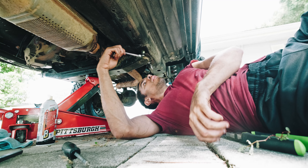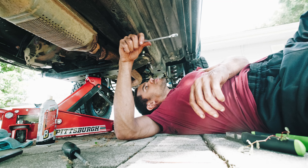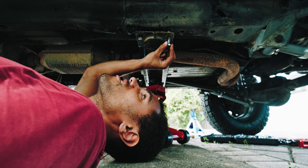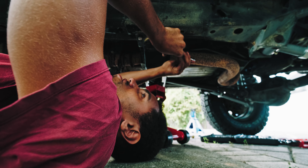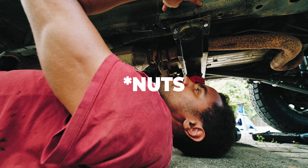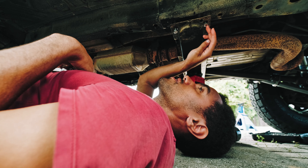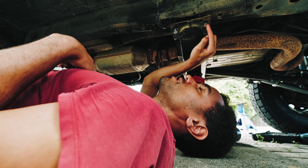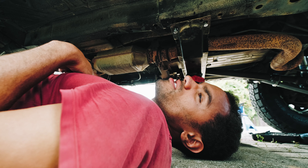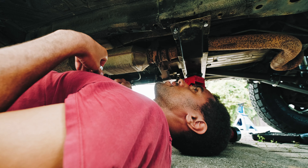This kit didn't come with washers — it fits, but you know what washers do. The only thing people were saying online was to keep the old hardware in case you want to install an SYE later. Looking online, people say it's common to actually strip the bolts inside, and a common fix is to tap to 7/16 thread — basically go up a size, get a new bolt, re-tap the threading to 7/16, and then the new bolt should fit. I have access to a drill, I just have to go get the tap. It looks like it's about to rain again — I'm just exhausted.